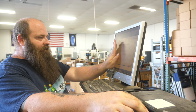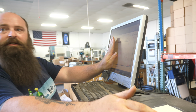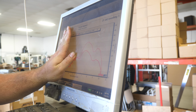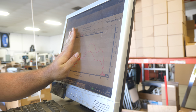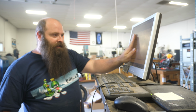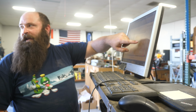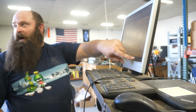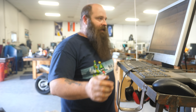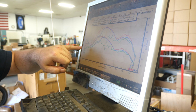Again, if we look at the top half of the graph, that looks close to what I would expect. We're at 36.66 horsepower at 7,360 RPM. You've got that peak once it comes on the pipe, which I would expect, and then it dips off and you get just a little bit of over-rev peak there. I think that's pretty accurate. That is awesome.